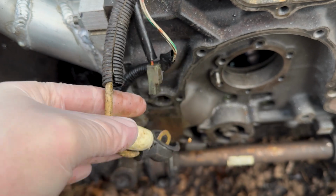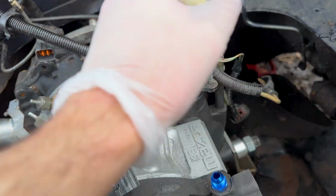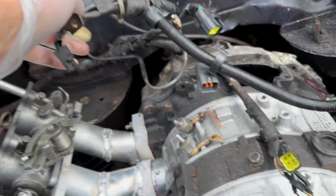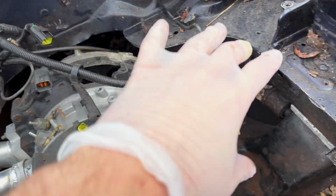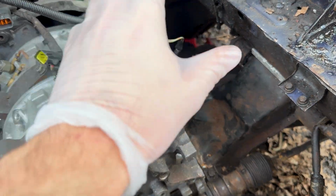That's the alternator, which needs to be extended, moved round to here. So I think a lot of this wiring, that's obviously the starter motor, which is going to be down there. So that main part of the loom needs cutting up, sorting, adjusting, and neatening up and tidying up.